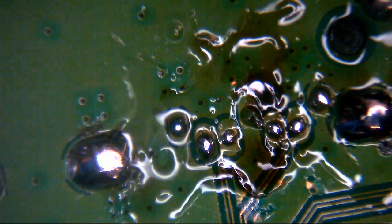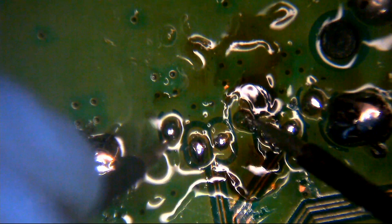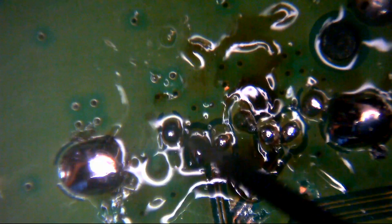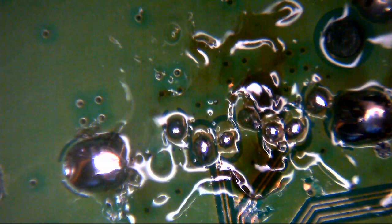So, meter in continuity mode, one pin on there, another pin on there, no continuity, open line, that's fine. These three are ground, aren't they, I think. Indeed they are. So these three outer pins here are ground, these are data, so we don't want them talking. So that's good, that's fine, that's alright.